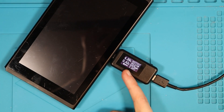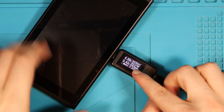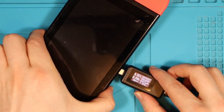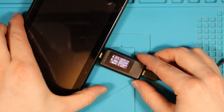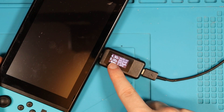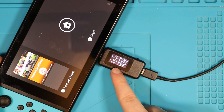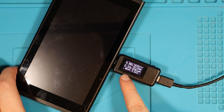We get 0.42 amps on the draw, so the battery is taking 0.42. For comparison, on a known-good Switch that I fixed last week — if we plug it in, it goes 0.08, then jumps up to 0.46, we get a battery display, it restarts back to 0.00, and then goes up to 1.4 or 1.45 for fast charging. That's what should happen. Clearly something is wrong with this Switch because when we plug it in, it goes to 0.42 and just stays there.